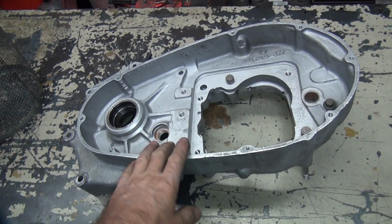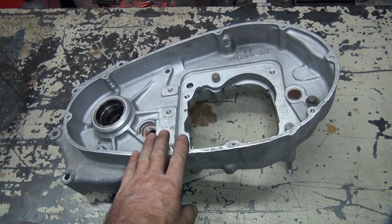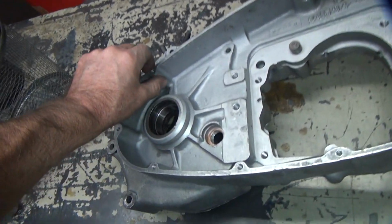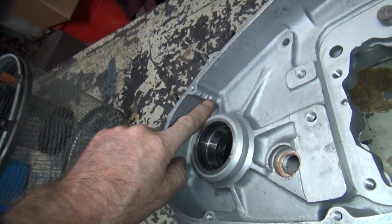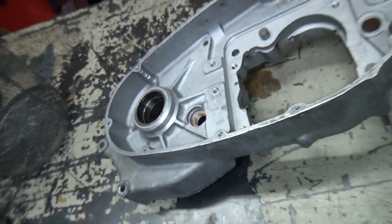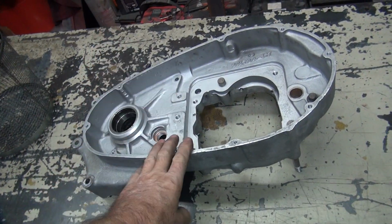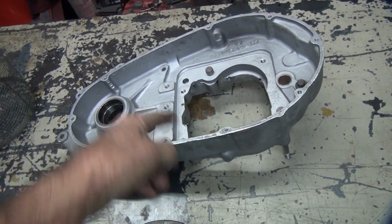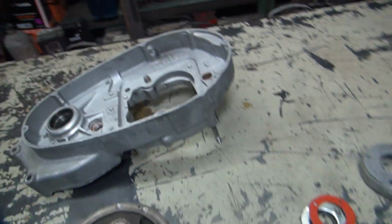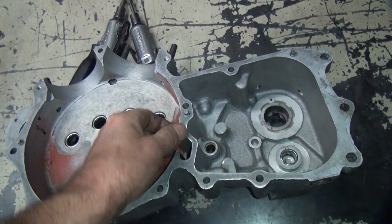Yeah, but you figure at least every other motor oil change, you should change the tranny oil. But not very many people do that. When the chain gets too loose, it starts doing stuff like this. It eats up on things. So there you go. Every second oil change in the motor, change the tranny and adjust your primary chain. Simple. That works for any bike.